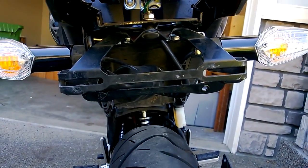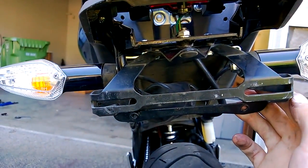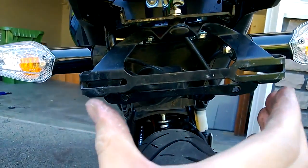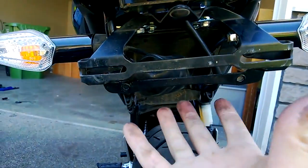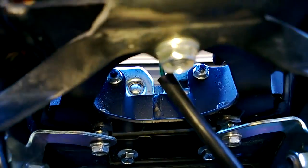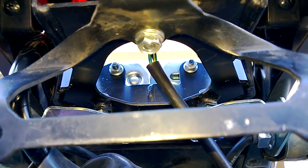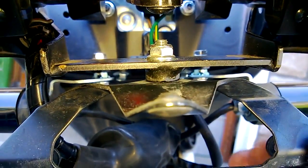You still have to think about how to mount the license plate. I bought mine in California, and I don't know if they require bikes to be sold with these reflectors and things. But this is the original license plate mount — I didn't make this, it just came with it, just shaped differently. There's this hole right here that the fender used to mount to, and a hole in the license plate holder that existed before. So I just put a bolt through the hole, put a nut on there, and tightened it on.